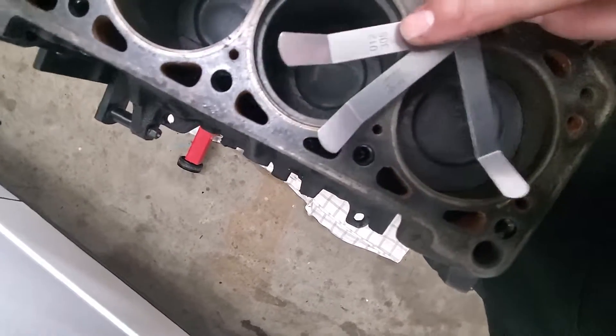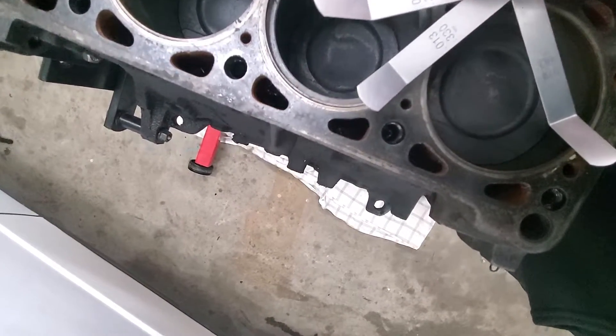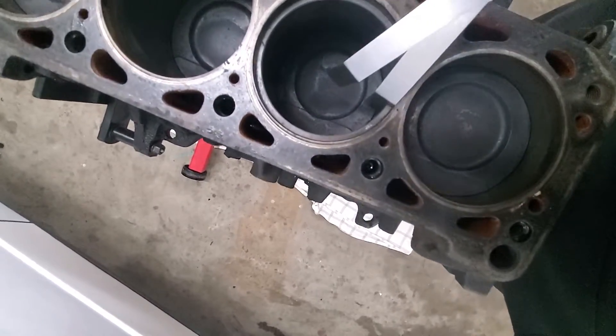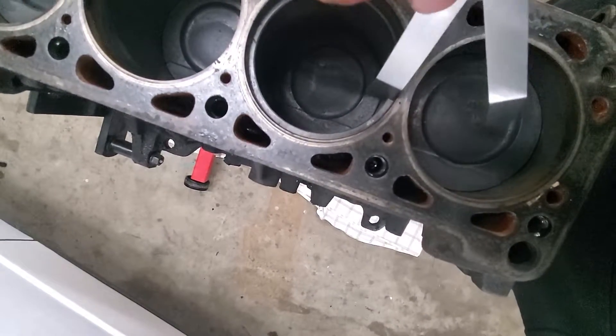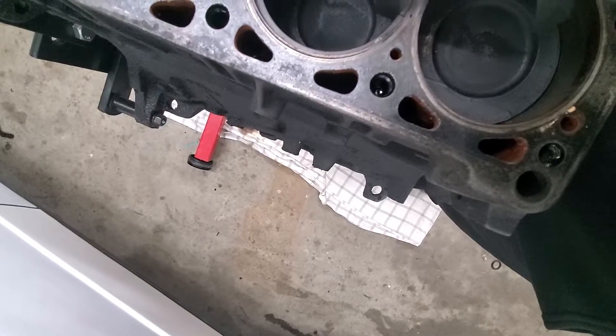Since we're doing some other modifications, we have to make the piston gap a little bit larger. I want to go between 12 and 13, meaning a 12 should slide through — that's the piston gap right there — and 13 should not go in there. But here we have actually 19, and 19 is the biggest one I can get through, so that's too big.